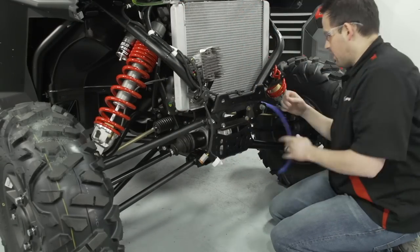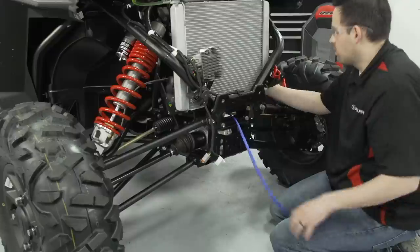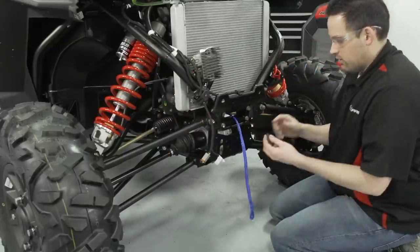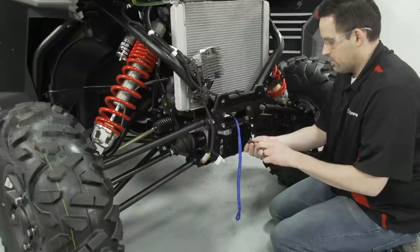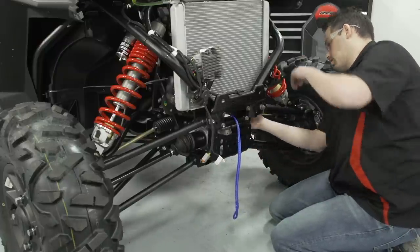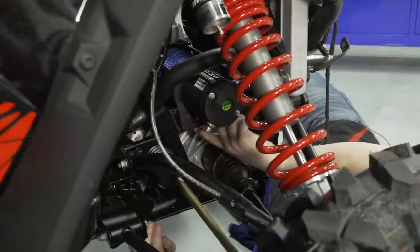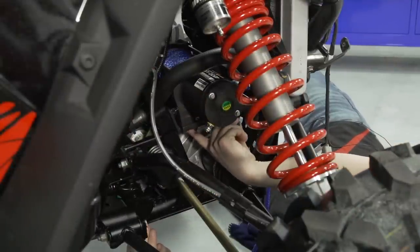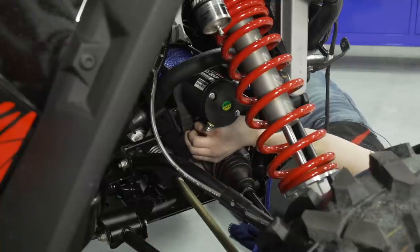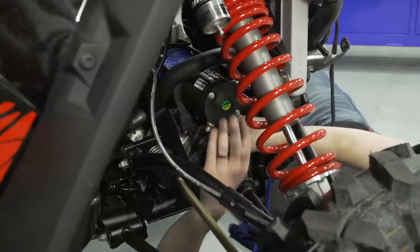Come through like that and push it back in the chassis. Run the rope through, then mount the winch on the plate using the provided fasteners with a 13mm head, coming in from the bottom and torquing to specification. On the mounting plate the winch has two holes — an inner and an outer hole. We're going to be using the outer holes for our fasteners. Install fasteners on both sides.